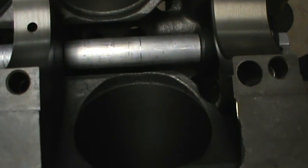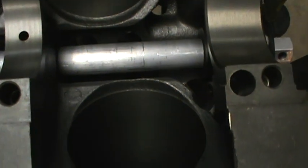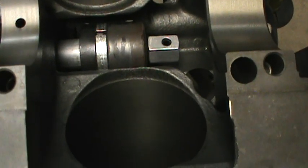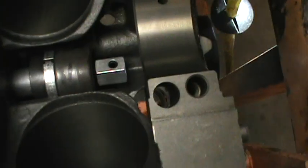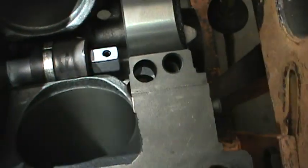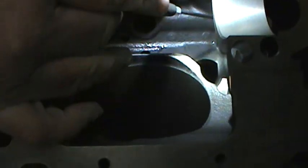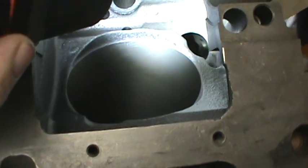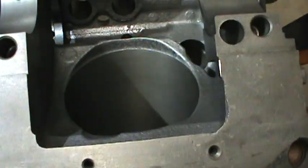Since this one is going into the back, I know my cam bearing driver has to go deeper. Then I take my flashlight and I can see the back of the groove. I come in with my pick and check — there's that side of the hole coming from the back side, and there's the groove on the other side. Looking right here I can see I had it dead center. That's how I do my cam bearings.